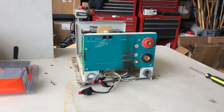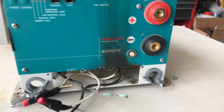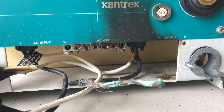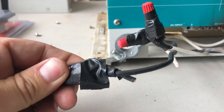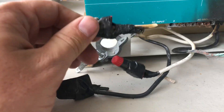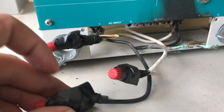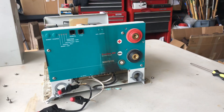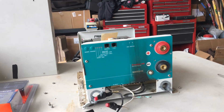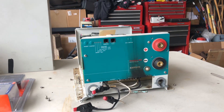In today's video, I'm going to show you guys a Freedom 458 inverter charger that I've recently diagnosed — it needs to be replaced. As you can see here, we had a small electrical fire inside the unit and it put itself out. This is one of the reasons why we tape up the wire nuts. Driving down the road, these connections can come loose, create resistance, heat up, melt the wire, and start a fire. Thankfully, the Xantrex Freedom 458 is designed to contain it and doesn't typically burn down your motorhome. I love Xantrex products — I think they make a great product.